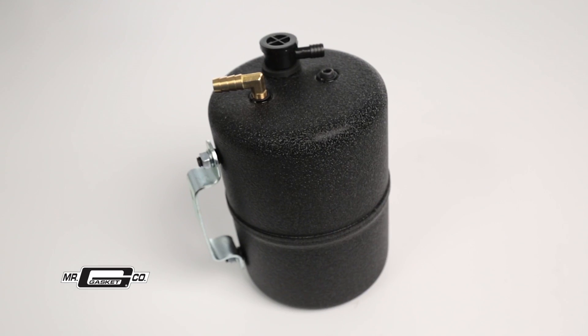When you're building an engine with maximum power in mind, a big cam seems like a good idea — that is, until you hit the brakes. A long-duration cam typically offers less-than-ideal manifold vacuum, leaving you with increased brake pedal effort and hit-or-miss climate control operation.